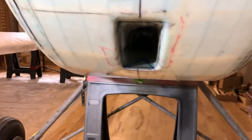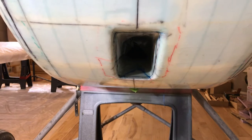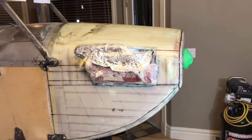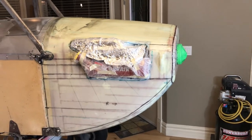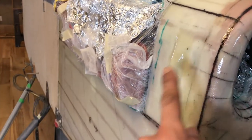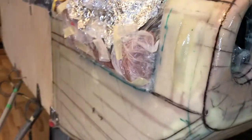I've shown you this tunnel before — that's for the air intake to the carburetor. That needs to be finished off once the cowl comes off, but I'm pretty happy with it. Happy with the shape. I'm going to block-sand it, body-fill the areas that need it, then prime it and cut it in half. I also had to put in a little relief here because this is the alternator bracket that bulges out there, so I had to make room for that — a lot of work.